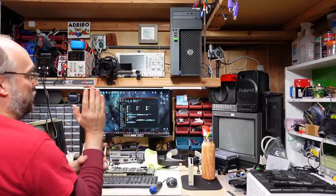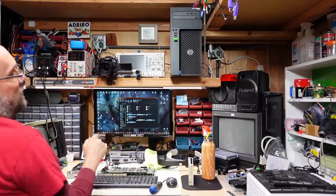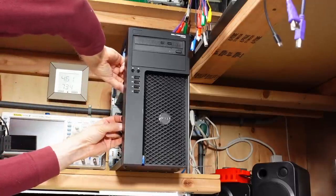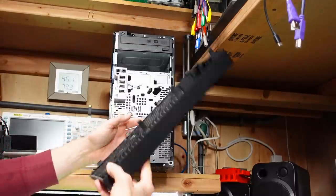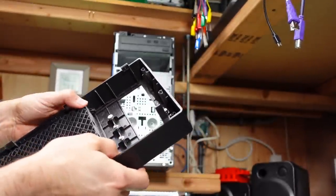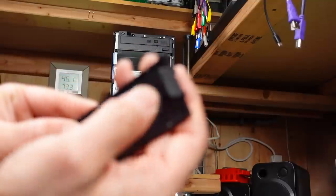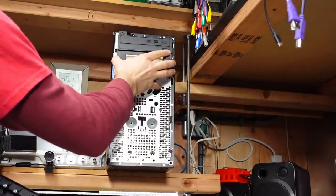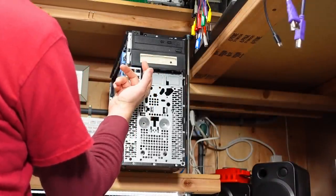I have the TPM enabled and configured, and I migrated from password mode over to using the TPM. The key to switching BitLocker from a password at boot over to TPM is a command-line tool called manage-bde — BitLocker Disk Encryption. Now I'm going to take this opportunity to remove this front panel drive bay cover. It was very stubborn — it felt like Dell designed this to come out one time and snap off in the process. The ZIP drive goes in here — I can't hook it up yet because I don't have the right adapter, but I can at least install it.